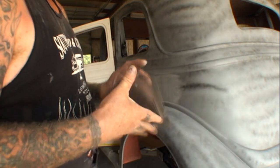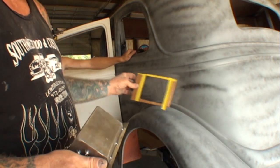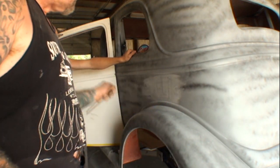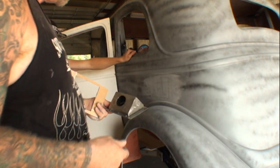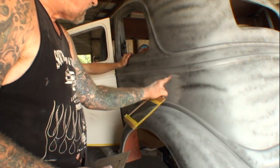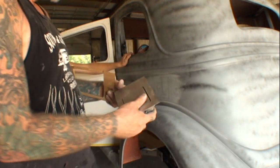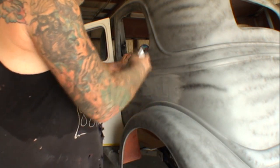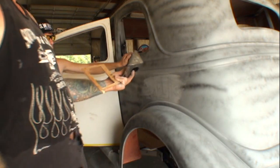Hell yeah. So we cut the pattern out, and we measured this out here. There's our pattern that Dylan made, and you can see it right there. Now what he's gonna do is drill each corner on this. You don't have to be really precise, but you want to be pretty accurate because this is the only room we got around the edges, so let's not mess it up, okay? Then we'll fit this in there, draw around it one more time, and start recessing this into the fiberglass. Thank God this is very, very thick fiberglass, feel that? Very thick, so we'll be able to mount that in there, and then drill lots of different size holes all the way around. Bam, bam, bam, weld our filler on here, route it to the gas tank, we're done, dude. Get it done.